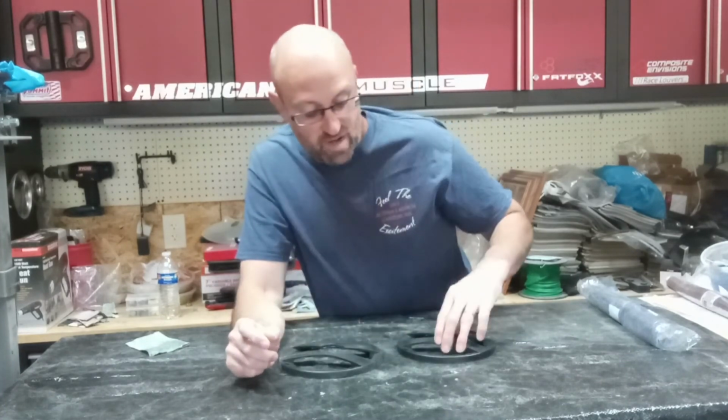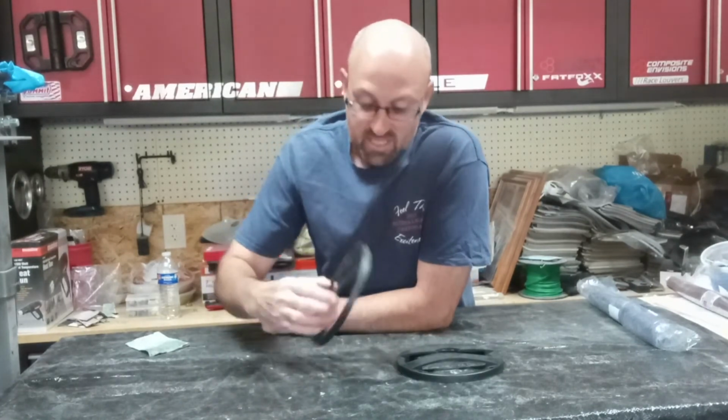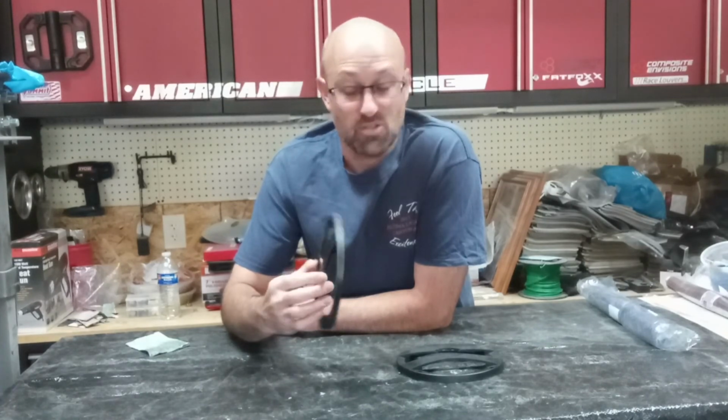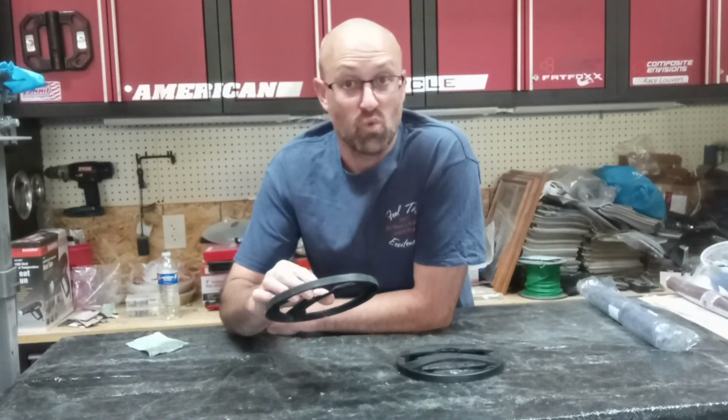Now, as you look at the speakers, they're going to have a slight dimple grain to them from the manufacturer. But with that, we're going to use some 80 grit sandpaper. We're also going to scuff it, and then we're going to hatch the edges, both front and back surfaces, to make sure that we can get this carbon to stick down very well.